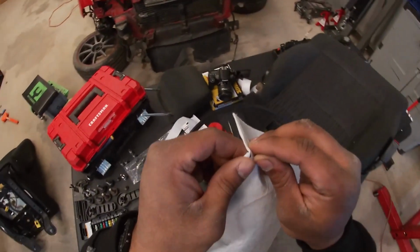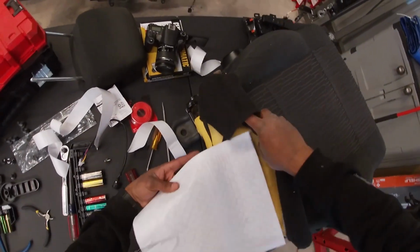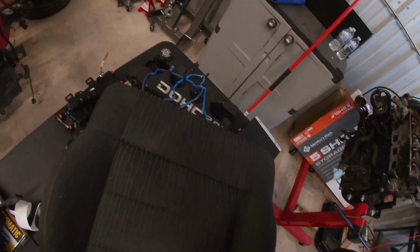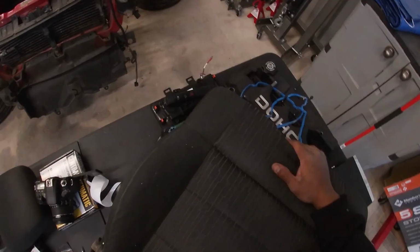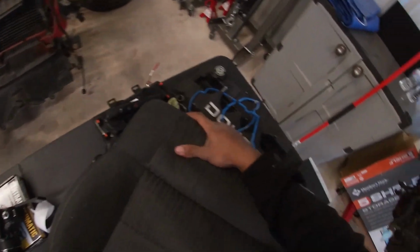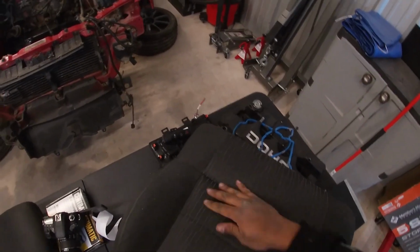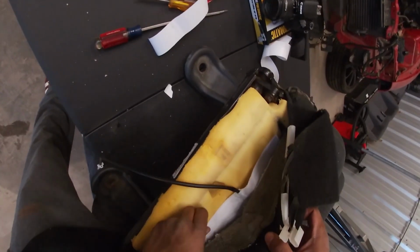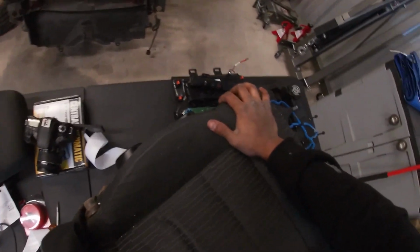Again, take off these adhesive strips, sneak up under here, slide this puppy in there. Now I'm just making sure this thing is seated all the way up to this crease right here. I have to go from bottom to top a couple times just to get this thing to go properly. Sometimes the pad likes to kind of roll up, so I think we're almost in position. I think that's pretty good. Make sure that's all squared up on the bottom. And then let's press that adhesive down.